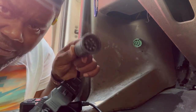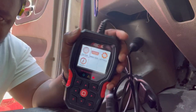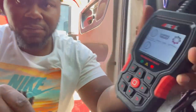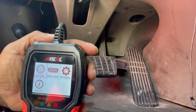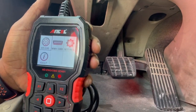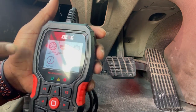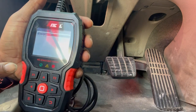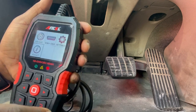Freightliner uses a nine-pin connector, if you didn't know. Notice how the power cuts on immediately as soon as you plug it in. We're going to click HD OBD — you can see the screen, we have HD OBD, WWH OBD, and Settings. If you want to go to About, you can, but it's not a touch screen — I made that mistake the first time I used it.